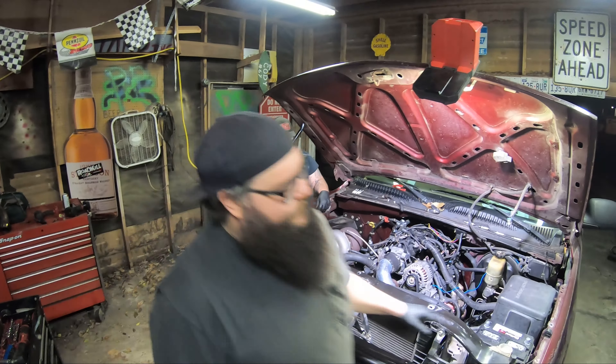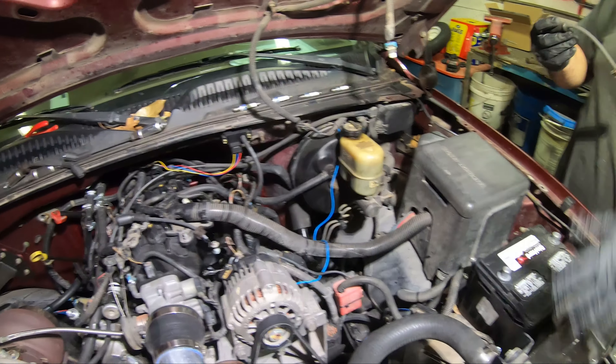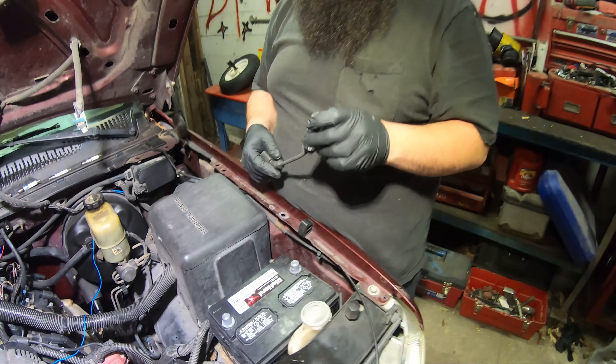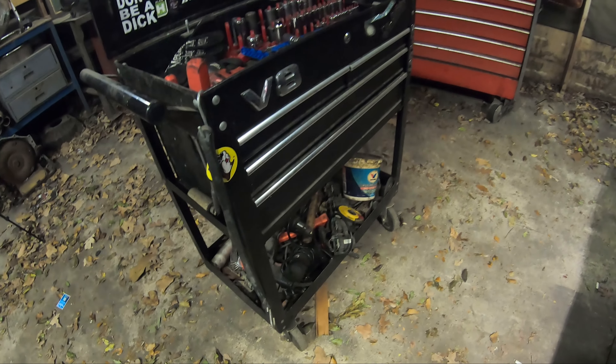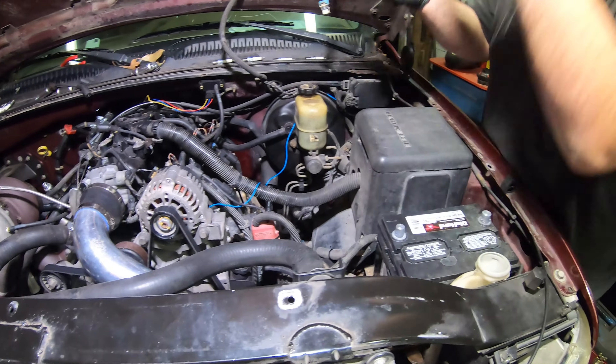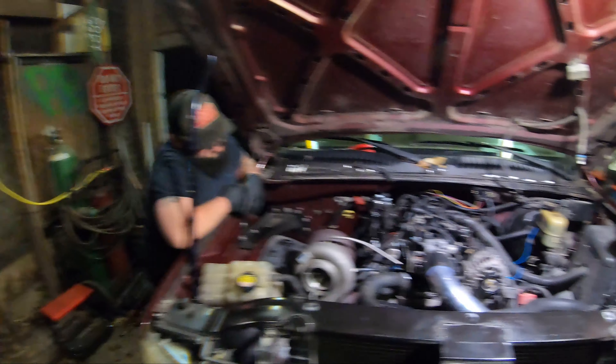There is a little oil on this one. A little? What's a little? Because a little and a lot are different by my standards. That's what happened — the misfire came from this dude back here. This plug wire either came off or your coil's dead. I mean, they're everywhere so I might as well just replace it. Oh no, I lost the spring — that's why it's misfiring.